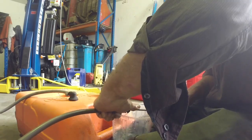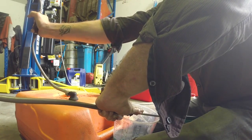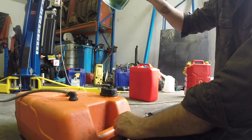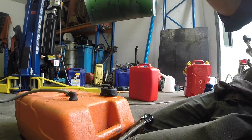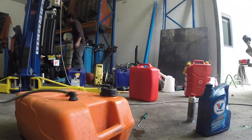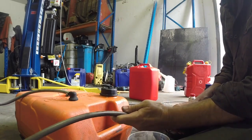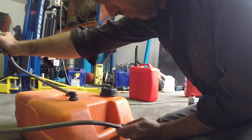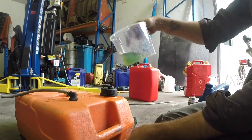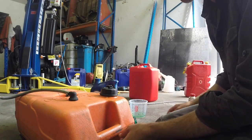There's definitely still water in that fuel line - so don't go to all the effort of cleaning your tank and doing all that only to run water back through your carburetor. You can still see that possibly in the bottom there's still that layer. I'll tip this out and do that again just to make sure we're clear. It's only a mistake you ever make once - to go to all the effort of taking a carb off, cleaning it, and then putting water straight back into it.